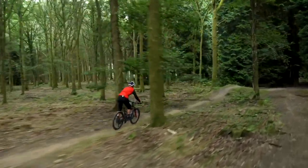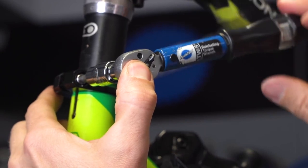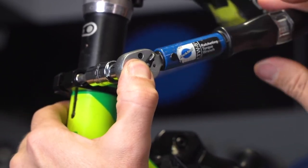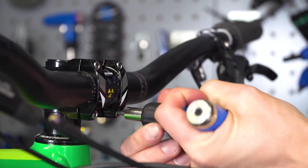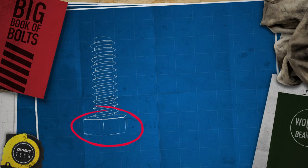I think sometimes I'm often skeptical about five newton metres or other torque specified ratings, because most of the time, in bicycle components at least, they don't specify what we're treating the threads with, if at all. Five newton metre torque reading with a lubed bolt is drastically different to the same torque reading if the thread is dry. I'm sure we've all turned brake bolts where they have so much compound on them they're hard to get in or out. Well, take that experience and apply it to the bigger picture. Is it tension at the head, or friction in the bolts that we're measuring?